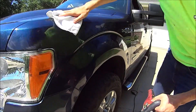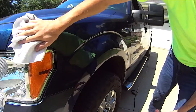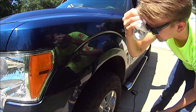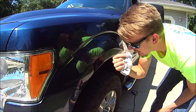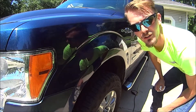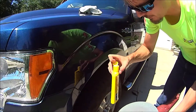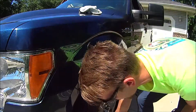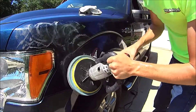Now that we're done with this, just quickly wipe it down in between, get it off your headlight, any crevices, creases, corners. I did spray this down and clean it right before I started, just like I did the backside, and boy oh boy, that's already pretty much done. I'll hit it with the medium just because. This one went through the clear coat just like that back one, so you'll still see it if you catch it — you'll catch the dent. Maybe I'll get fender flares one day to hide it. Let's get the medium pad. I used to have a soft pad but I think I killed it — it would be nice to go through all three, but it's looking good with just these two.